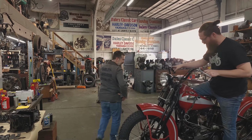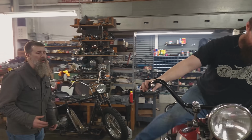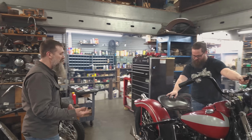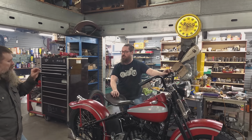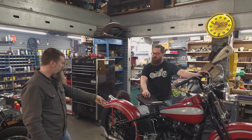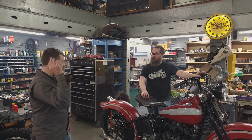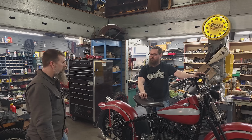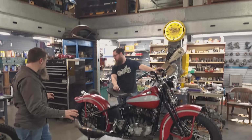It sounds great. Feels good. Yeah, really, dude, it's a ton. That's the thing about the flatheads, man, there's so much torque with this bike. You can run down the road 70 miles an hour with relative ease. I think if I remember right, we did a 23 motor sprocket, 24 tooth trans sprocket. So this thing is gonna honk. It'll run 70 all day. It'd probably wind out to 95 mile an hour the way that it's geared.